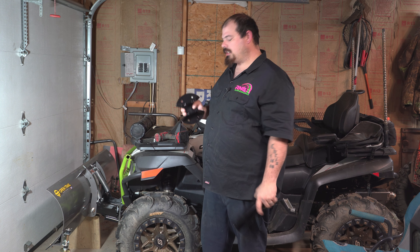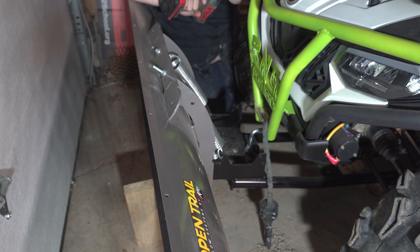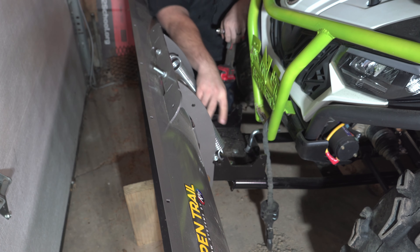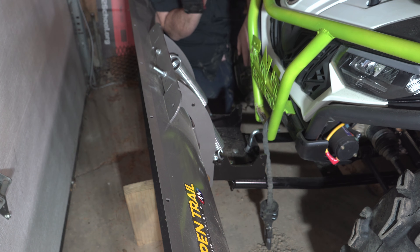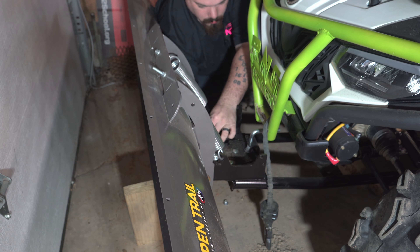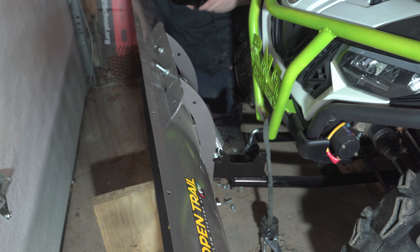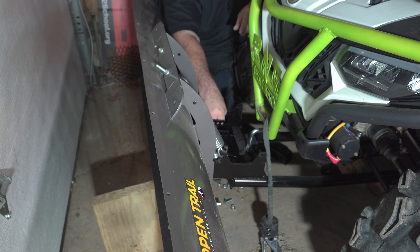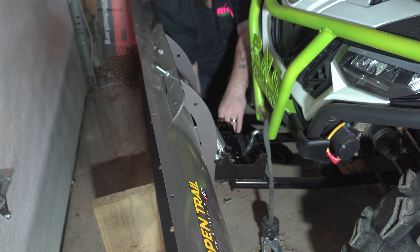Let's go ahead and get into this and show you how to install this and what it does. For this install, you're going to need some basic tools — a 14 millimeter socket is pretty much all you're going to need. Down here you're going to see the four bolts across from each other. Those are the ones we're going to want to take out. Today we're going to use an impact gun because it's faster. I just took this spring off real quick — you don't have to do that, but I'm crammed in a corner. So now we're going to take our plate — it comes with some longer bolts. Just going to want to get those down in there, go ahead and get our nuts on, and tighten it up.